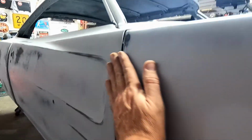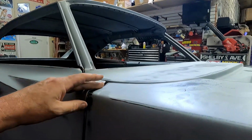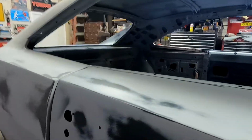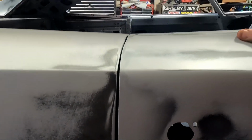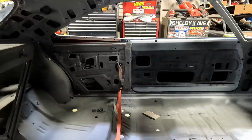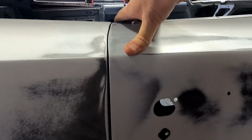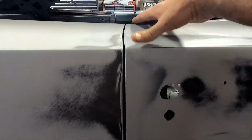And that's perfect. I mean, all this door looks pretty darn nice matching up, except this, just the height thing is to kick up a smidge. So the way I mounted these is still this, you can see it's a little high. That's got a chain in the corner of that one to bring it down to level, and should take about 30 pounds worth of pressure with window and regulator, all that good stuff, to bring this down as well.